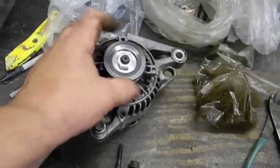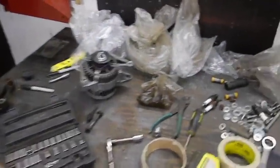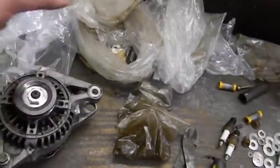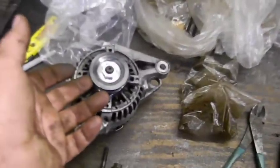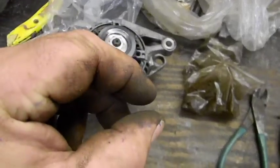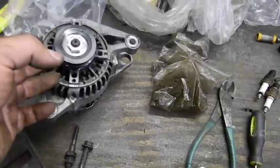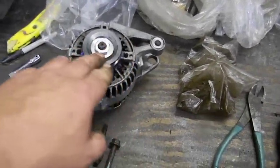The bottom line with this pulley is, it might look funny because there's paint and no paint on it, but it is true. We'll keep that quick so we can move on to other things. I went down to Anflo today. I had that all broken down and handed it to him. He came back with the pulley and said, here's the deal. The pulley's rubbing the housing. So he gave me a tiny little spacer. I'm sure you people have seen the spacers, but the problem was when you put the spacer on, you weren't quite catching all the threads on the outside.